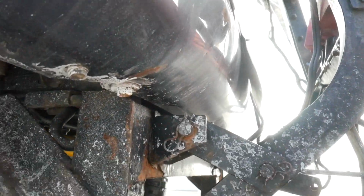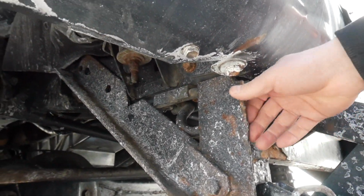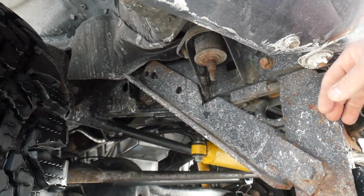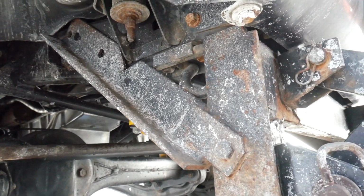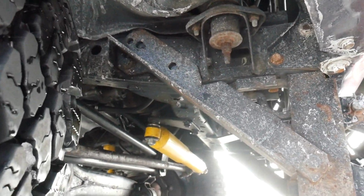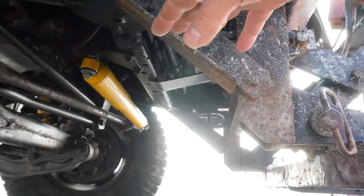Anyway, I'm going to show you about the bracket I've used to attach it to the truck. So this is a Western Uni-mount bracket for a Ford Bronco 2 or a Ford Ranger. It came with the plow when I bought it used several years ago. I don't know that it's the best for this vehicle. However, it's been modified to fit. I think there probably are better ones that would fit a little closer, but you're going to be doing a lot of cutting and welding anyway.